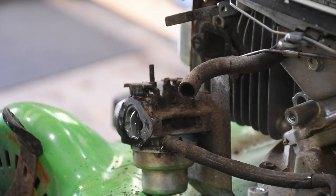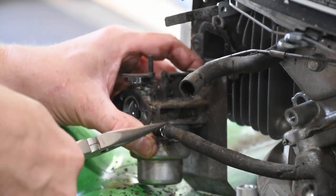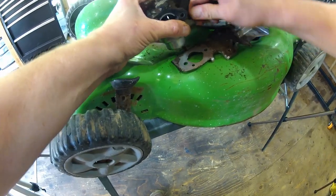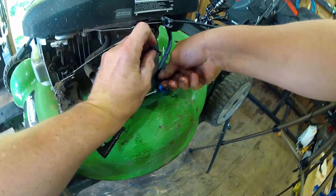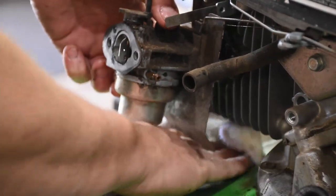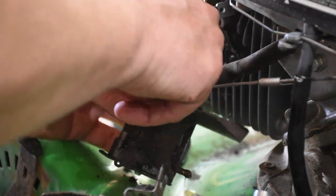The next thing we'll do is take off this fuel line. This has been on here for quite a while so we'll use a pair of pliers to get this fuel line clamp off — I ended up just bending it, and I've got a whole box of these so I'll just replace it with a new one. These lines can be tough to get off when they're old. I tried prying it with a screwdriver first but eventually brute forced it off, which revealed that I forgot to shut off the fuel petcock. You can see me here struggling to get it turned off — so the gas won't flow anymore. It's always fun when this kind of stuff happens, but you know, I'm not a mechanic, I just tinker on this kind of stuff. We'll just clean this up, and you can see how dirty that carburetor really is.